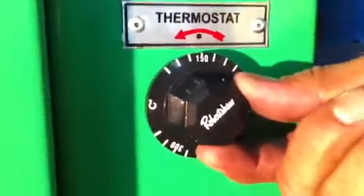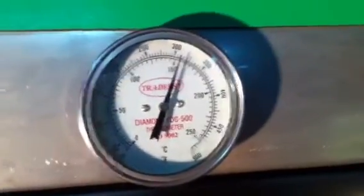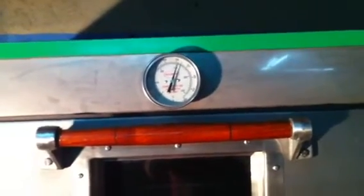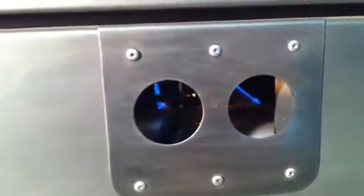For example, if you want to set the temperature to 150 degrees centigrade, check the thermometer. If it is already at 150 or has slightly overshot, you may need a little adjustment. Most of the time a small differential between the thermostat control and the thermometer is acceptable. You can see it's almost 150, and the burner is showing a very small blue flame — that is the automatic stage of the burner.